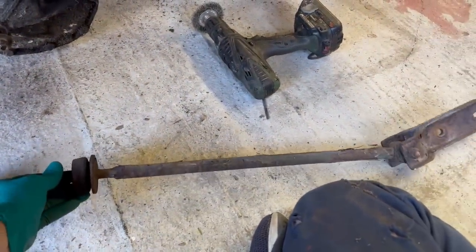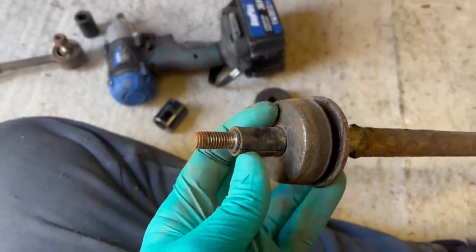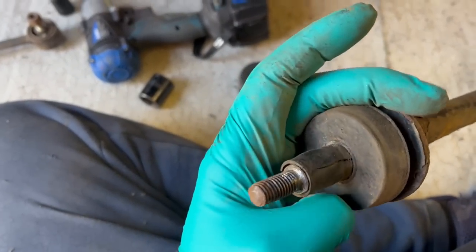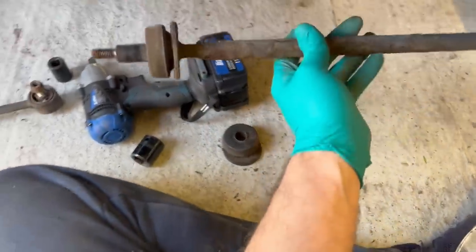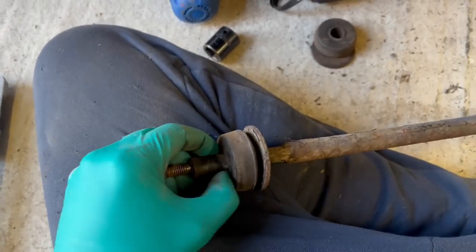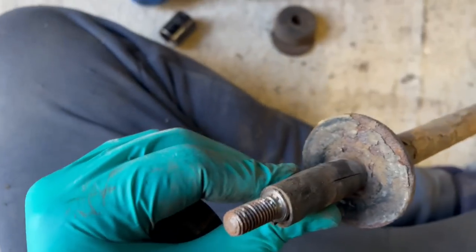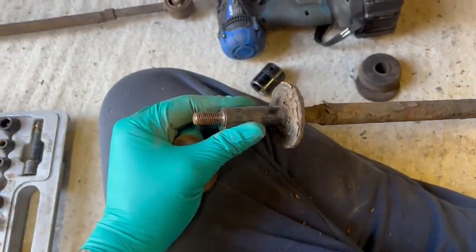Just a quick side note, just pulled that trailing arm out. Not only is it nice and straight, but the plastic sleeve that goes through the bushes, through the rear axle, it's split, but it's still there. Most of these cars, that wiggling up and down contacts in there, grinds that away, and this basically can get ground down too. So that's really nice to see. The whole thing is there. That's quite unusual. Still needs replacing, but again, just shows that this car really had done low miles.